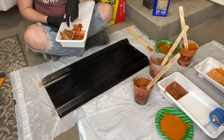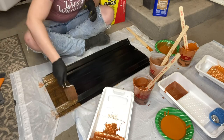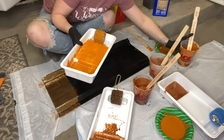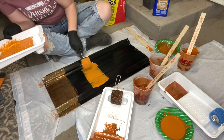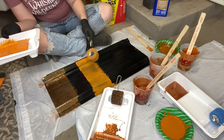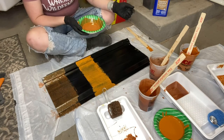As part of my test I also wanted a dark background, since many people have dark-colored vehicles or use dark primer. The base color or primer color really dictates how well these metallics cover. On the black panel, the copper metallic by itself covers really nicely. Then I'm rolling Zombie Sunset on the second section so I can apply the metallics over top to compare coverage.